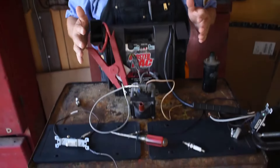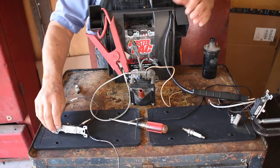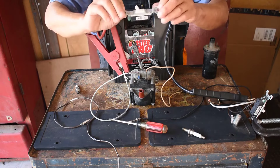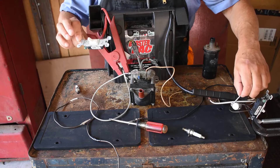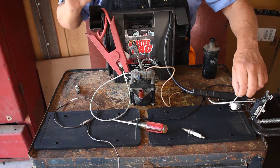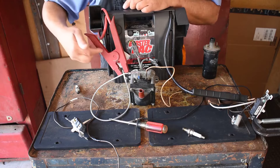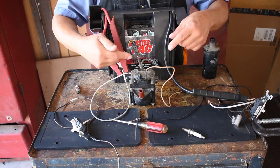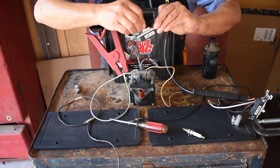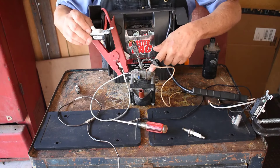How does it work? Let me show you. Right over here, I start with a 12-volt battery. I've got this other coil set up so it's a little easier, and I've added a special switch — just a plain old house switch — but I've added a condenser, like a points-and-condenser setup. Ignition coils need a very special negative pulse. The positive comes to one side; this coil needs positive and negative, but the negative is going to be turned off and on very quickly. What turns it off and on? That's the next subject, but basically it's an ignition module or an igniter.